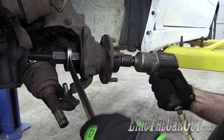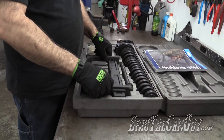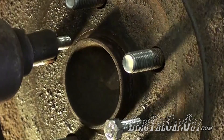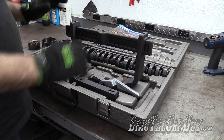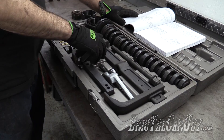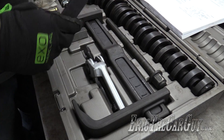So think about the value of that. Yes, this is a heavy 90-pound case full of a lot of different attachments, but it did the job. It does other things as well. In fact, this part of the tool — if you have a brake drum stuck on a car and it doesn't have those little bolts to pop it off, you can grab the edges of the drum and pull the drum off the brake assembly. In a lot of ways, this piece here and this bolt is the heart of the tool. It also comes with a two-jaw puller and other items for pulling things.